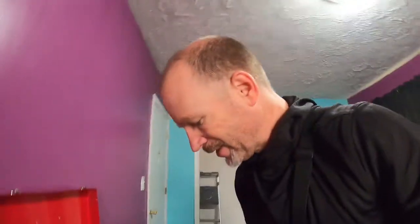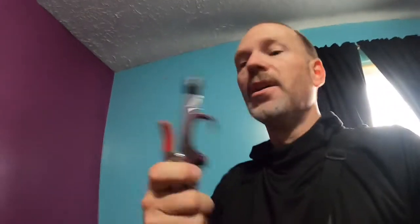How's it going everybody, it's Joe back again, still working on my GT, just taking my time doing it. I'm here today to give you guys a quick tip on how to remove handle grips without destroying them if you want to keep them. A lot of people use silicone with a hose to spray up in there and loosen it up. I got a different way I've learned over the years - if you got a little air compressor and a blow gun, it actually works a lot better.